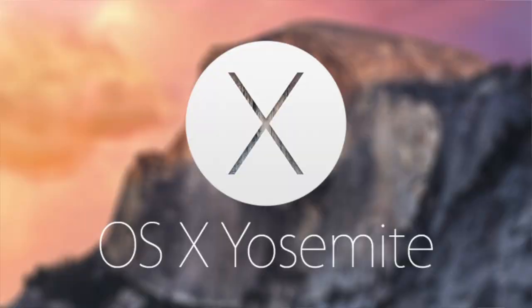So here's when I started having issues with this iMac. Basically what happened is trying to install macOS El Capitan and macOS Yosemite. Those two updates are the only Mac updates that require you to put in your Apple ID to download them, because for some reason inside of the recovery screen and really just any sort of download for that software, it requires you to sign in with your Apple ID to Apple's network. And unfortunately, those two softwares, since they're pretty old, we're talking like 2014 and 2015 software, those are no longer supported, obviously. So they don't really properly connect to Apple's App Store. So it always comes up with an error when trying to download using the Apple ID.